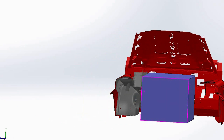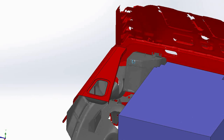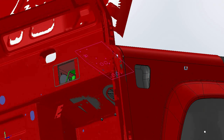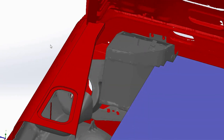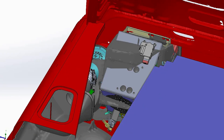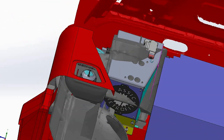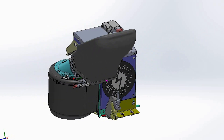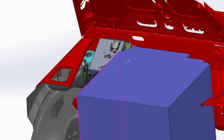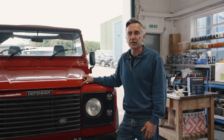Going way back — we actually started this project nearly a year ago, and we want to show you some of the processes we go through. We pretty much always start with getting scans of the car. We would scan the bulkhead, the interior, and that gives us a model that we're then using to package any heater or AC components inside or up against. There's generally a concept phase, and then we get into testing those concepts from an airflow point of view effectively in simulation on the computer.